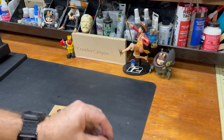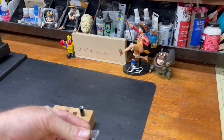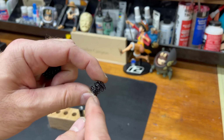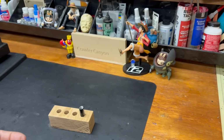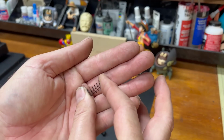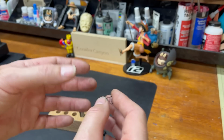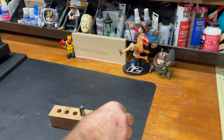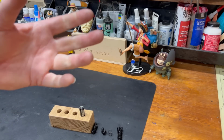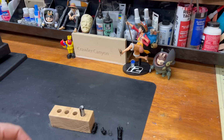Okay. So you will note, I've only in one instance used a heavier spring than the softest ones that they include, but that tends to be because I run them in droop. They've got some of these here that are very firm. On Jolly Green, I'm running the shocks upside down. So he's running the softest here, and he's running the medium here in the short above the piston, because he's a heavy boy. So they do give you a lot of springing options. He's 12.5 pounds-ish. Well, he does have 6 wheels. Yeah, so if you have a 12.5 pound vehicle that only has 4 wheels, you're probably going to need something other than the super soft springs.